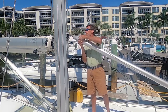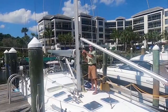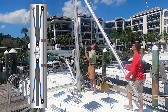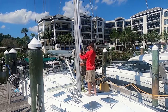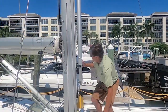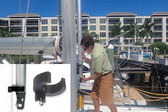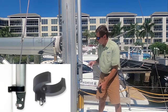This setup allows basically single-handed sailing. We've just raised the vertical pole storage system and it just snaps in right there. For the lower end, there are various attachment options. The most simple is called the VPC chock — it just snaps in. It's sold in various diameters and you just match the whisker pole diameter to it.